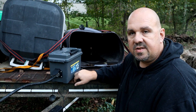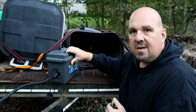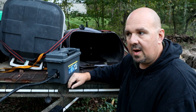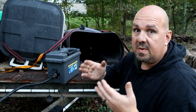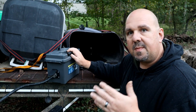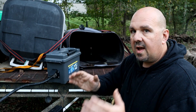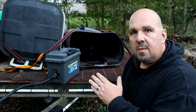That's going to bring us to the end of this video. As you saw, all of our functions on the trailer are working, all being powered by our little portable box. It doesn't weigh much — a couple of pounds, that's about all it is. Makes it super simple whenever you're wiring a trailer to make sure your wiring is correct, because you don't need a tow vehicle backed up, and you certainly don't have to go get your children to hit the brakes or toggle the turn signals — that just saves you an argument. If you build this project or have any questions, put them in the comments section. The wiring diagram for the switch is in the description — you can download the PDF there, and it'll show you all the wiring connections you need to build your own portable trailer light tester.